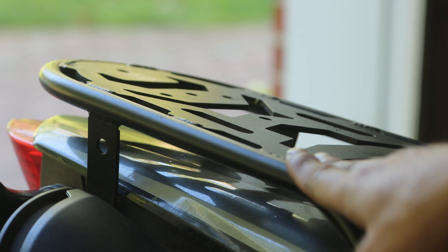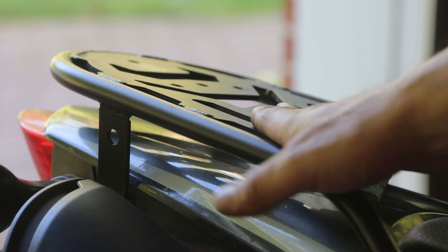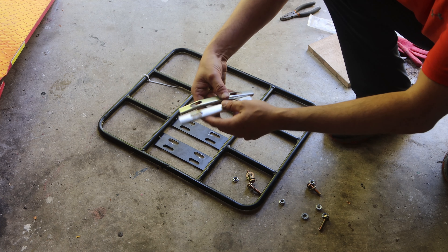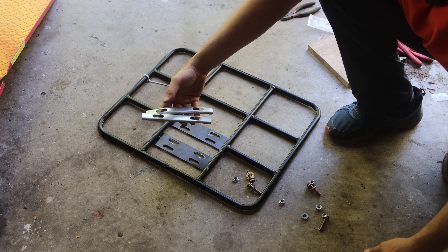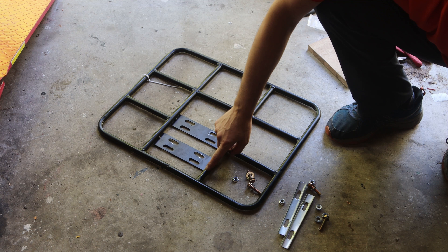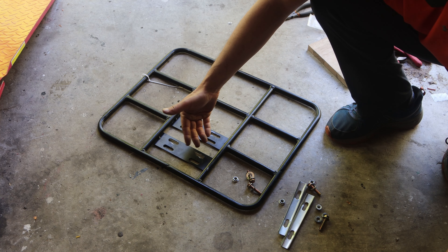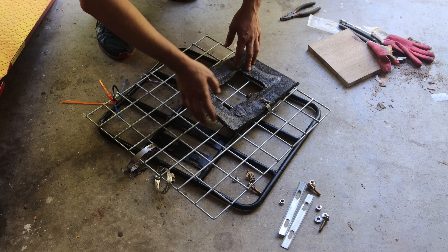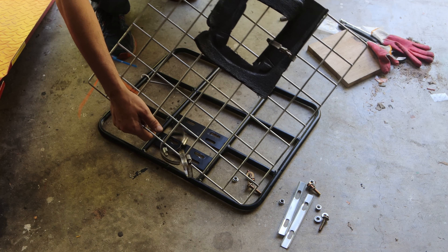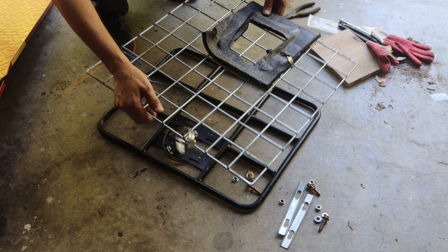You can put a whole lot more stuff on a large rack instead of the skinny racks that come with most bikes — manufacturers, please start making these. I have an existing rack on the CRF and you do need one to mount it, but it's a direct mount onto my Kamimoto rack. The rack comes with bolts and two brackets to sandwich onto your bike. Some bikes are easier to install than others — sometimes you have to drill into the rack. Without a solid mount it's too wobbly. The rack that comes with the bag itself is really unusable; I added modifications to help absorb vibration but it's just not good enough — it bends and actually breaks, creating too much flex.